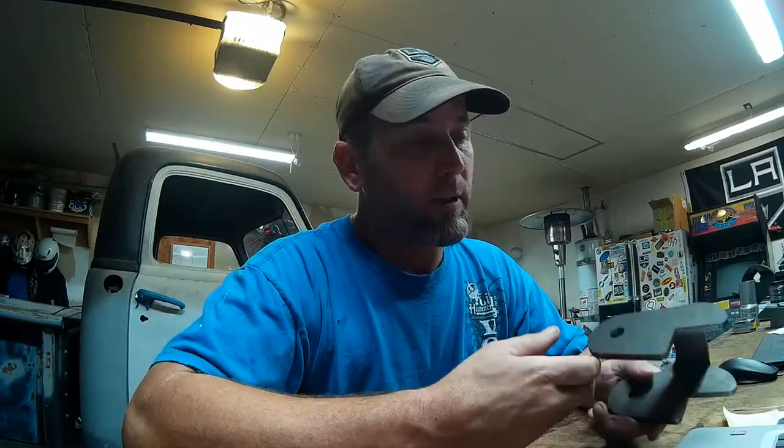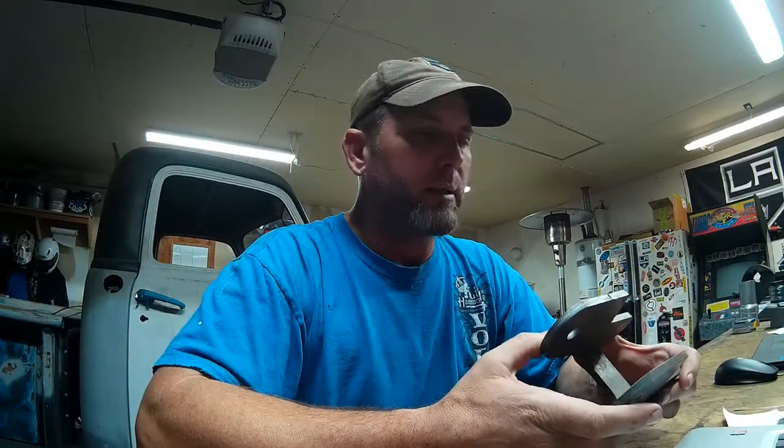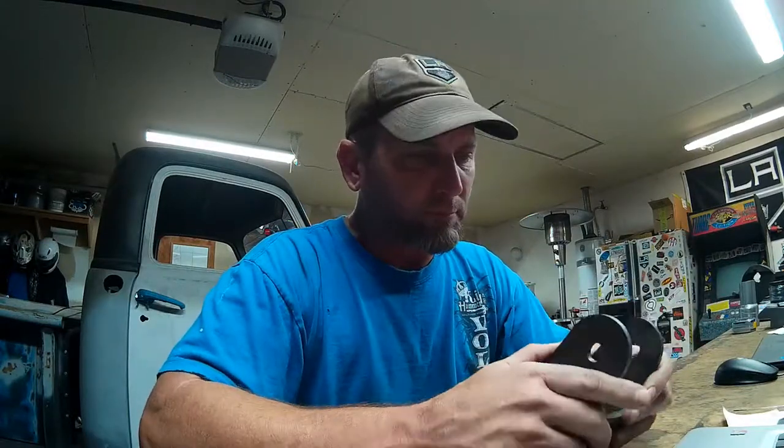And what I'm going to use is these control arm brackets I've had kicking around for many years here in my welding cart that I bought for a project I was working on back in my rock crawler days. What these are is a control arm mount that typically will mount into a transmission cross member or a square tubed axle, something like that, and you weld them on and then you locate your control arms. Well, the opening here is 2 5/8.